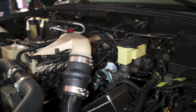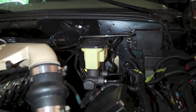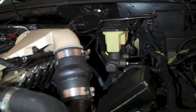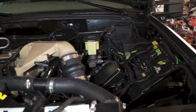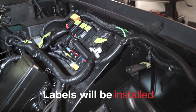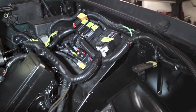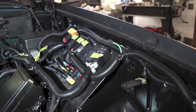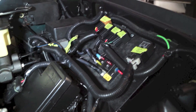All of the brake system is completely untouched for this conversion, so your ABS is all the same as well as the cruise control. Cruise control comes around and hooks up to the throttle. The existing Suburban throttle pedal was retained and the cable itself was modified. Over here you can see where the original engine computer used to sit — I created a little distribution center where I have all the relays for the LED light bars, the Dodge fuel solenoid relay, as well as a small fuse block for the added accessories.